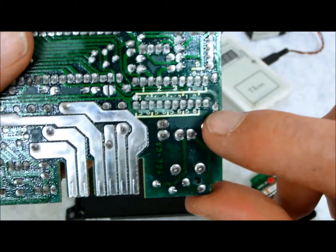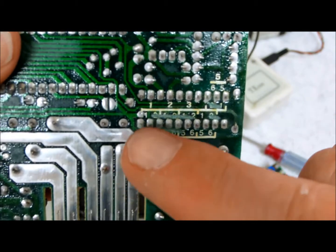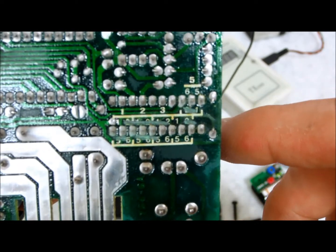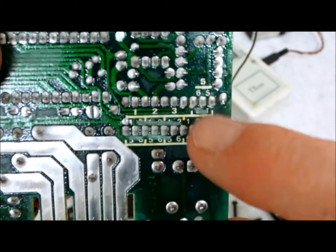These are all these little dots. You can see that DEI uses things called groups — group one, two, three, four, and five — and there are four sets of scribes. The way these things work is that someone at the factory took something like a Dremel and cut these little notches out, so that way a code is made for this particular alarm system.